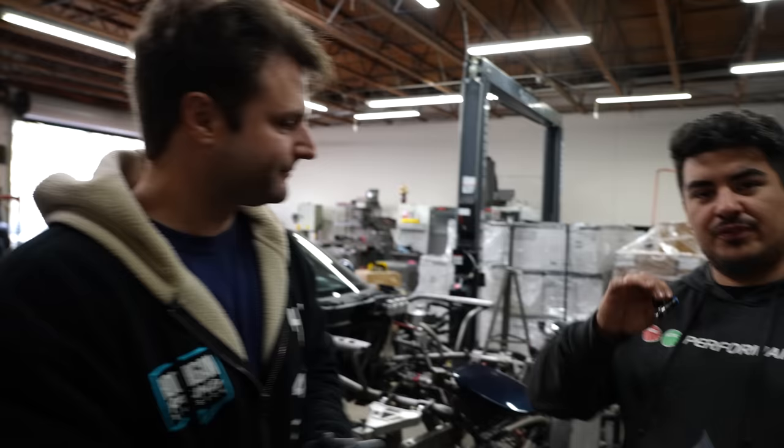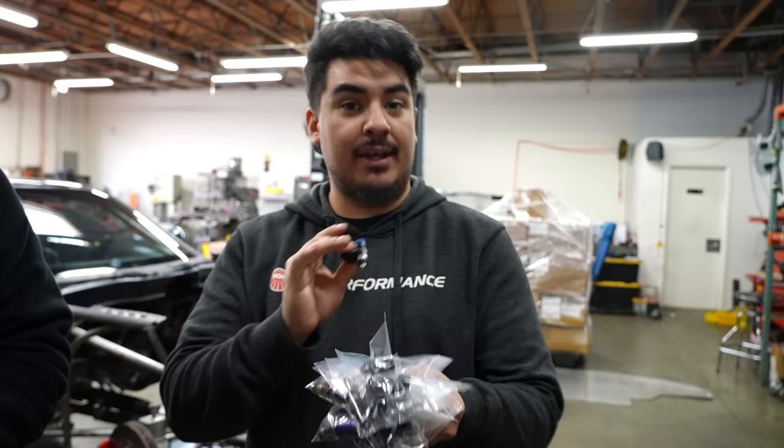That way, when we go and make all the adjustments per rotor for EGTs and oxygen sensors, we're not adjusting for the difference in injectors. Very important detail. This is more of a consistency thing. We want everything to be consistent, so that way the only thing that could really be messed up is the amount of fuel we're adding or the amount of air that's getting in.